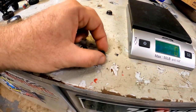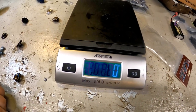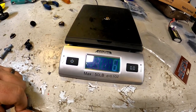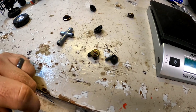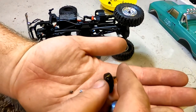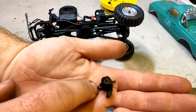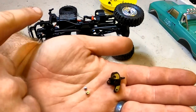Now that we've matched up old versus new parts — I took the axle and the bearings out of them — I have my precision scale here. It can't even read the stock piece. It's under a gram. New piece: six grams. So it should be a fairly large improvement in how much weight is on the front of this axle. I've moved the bearings and the axle over to the new hub. Note that in the kit, it comes with small aluminum bushings that go in the top and bottom to help provide your pivot point in the new hub. Do not forget to put those parts on as you screw everything back together.